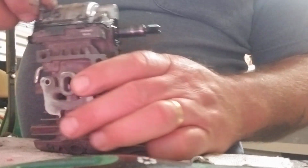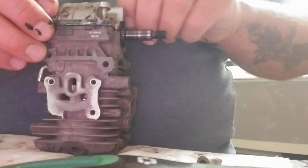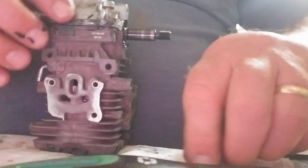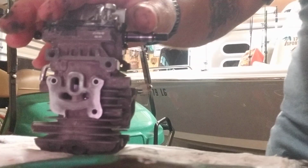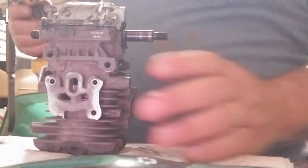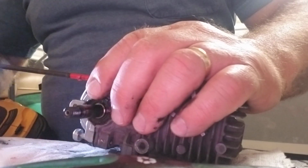Once you tighten it down, you're going to pull it snug. You'll know you've got plenty on it. It's going to go all around. Pre-start your screws. You don't want to tear them up. You've already pre-started the thread, and you don't want to run another thread. It will too. If you put them in a little bit crooked, it will restart a new thread on you and go in crooked. So get them started.